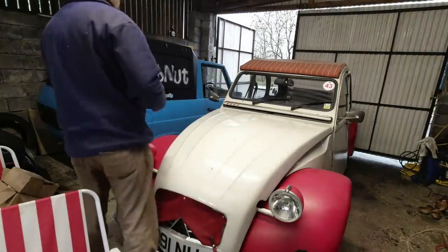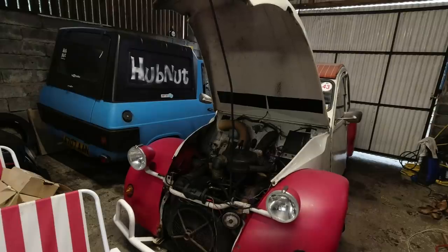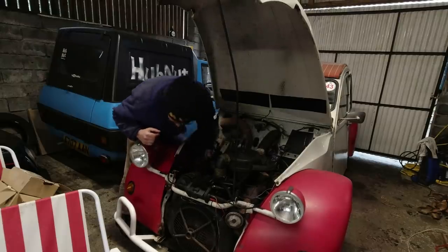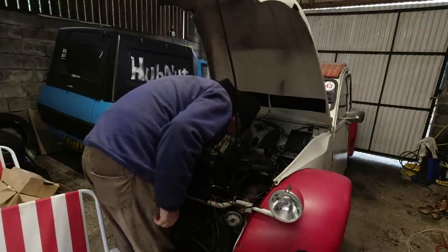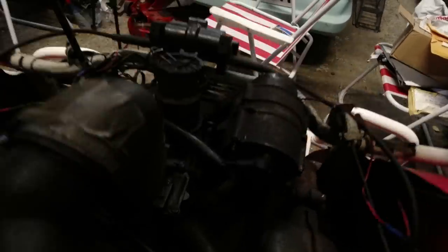I will see if she's willing to demonstrate, just to double check this is actually the problem before we get too carried away. Oh no, this is more serious than I thought. She's blown a hole in the manifold. I've just pushed back a flap of metal under here. That's getting very hot very quickly. That's where the blow is. Oh, that's not good at all.